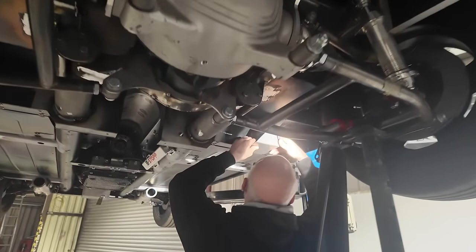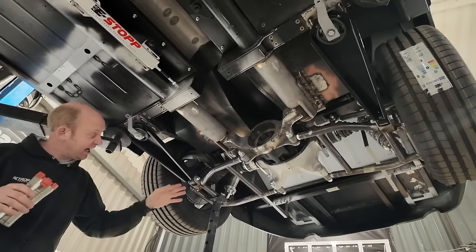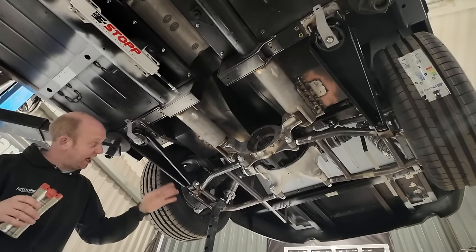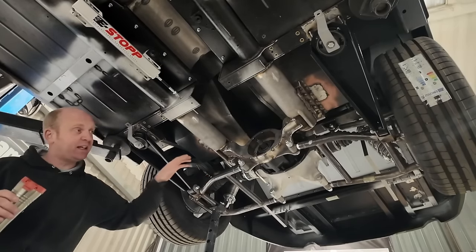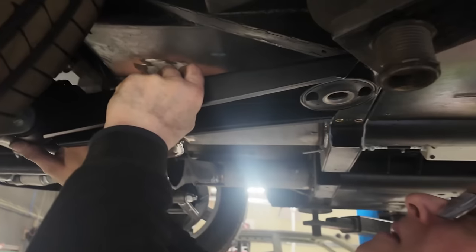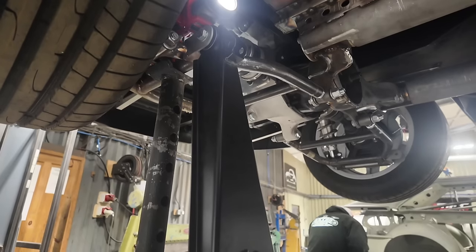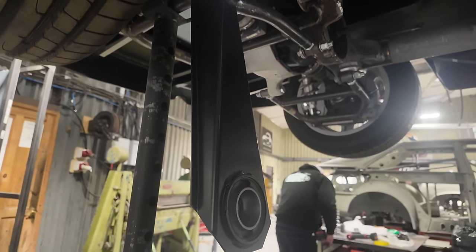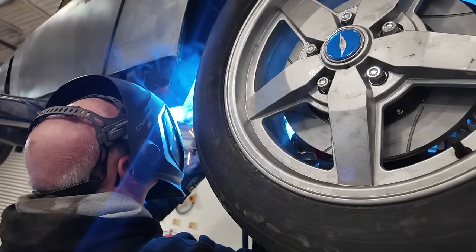It's my belief — and somebody mentioned this in the comments — that the Heynes rear end was designed as a substitute for a Jaguar-type IRS rear end. Sure enough, we discovered that the lower wishbones are nominally the same length as Series Jaguar XJ lower wishbones. So the angles they travel through are exactly the same as Jaguar arms, making it entirely logical to use Jaguar trailing arms in this application.